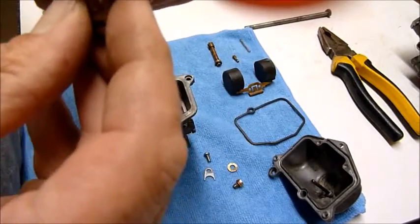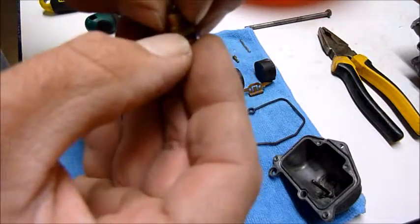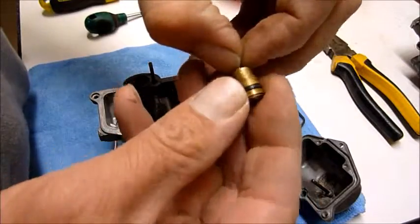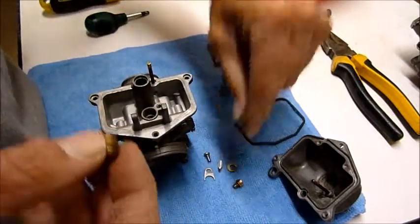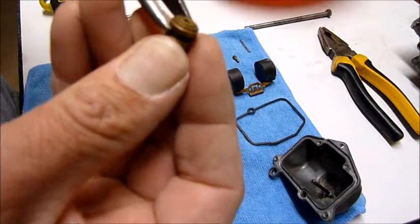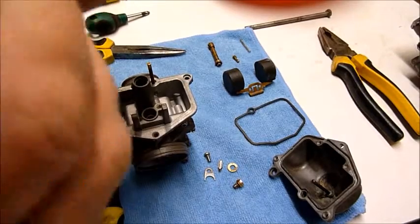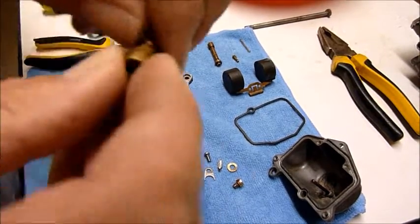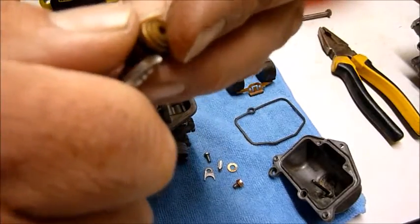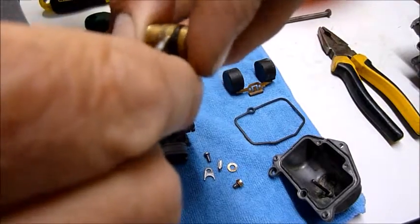See, what this does is it prevents fuel from flowing through the carby through your motor. Okay, so this O-ring's knackered, which this one is. You can easily see that by, just take it off with these because it's easier. This one's that worn that it's actually quite hard. I've had this off before and it's actually broken into two pieces.